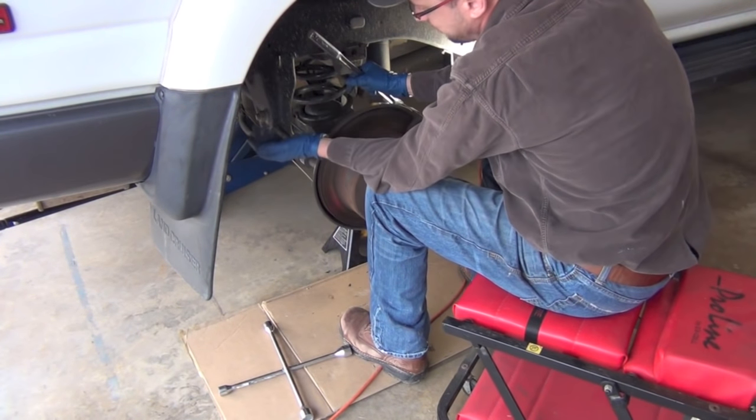Now I've got that sensor right in there — got it cleaned up. I took a little toothbrush and kind of cleaned those teeth and kept rotating it. You can rotate this if both tires are up off the ground — since it's a differential, the other tire just goes the other way. Just grab these bolts and rotate it and get your toothbrush right in there and clean those teeth. Then I shot it with a little bit of brake cleaner — it evaporates real fast. Just kind of spray this stuff off and get it clean before you start buttoning everything back up.